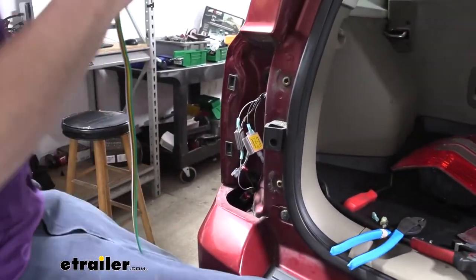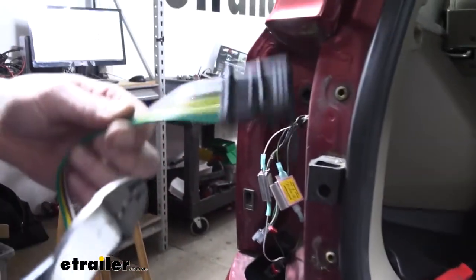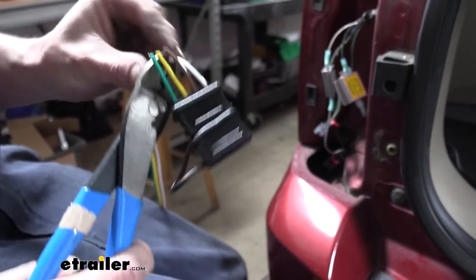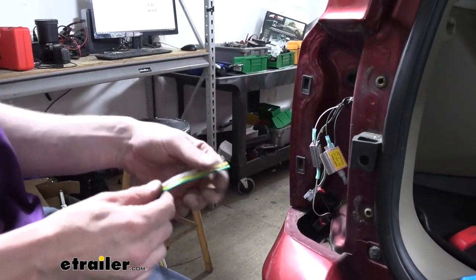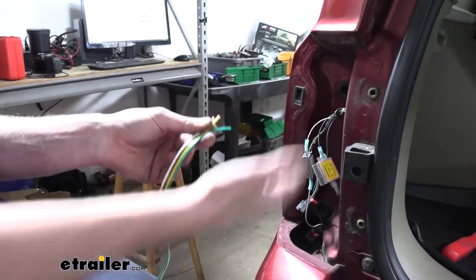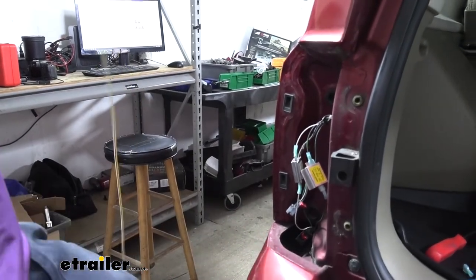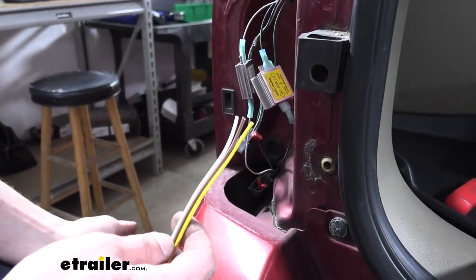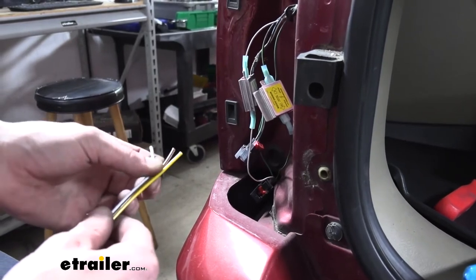We're going to go ahead and take this wire here and snip off the end we don't need. I did snip it off at a point where the wires were separate, because we are going to need to separate these wires. The green wire here doesn't need to be on this side at all — it only needs to be over on the passenger's side. So you can go ahead and peel that back some, all the way over to the other side. These remaining three wires we're going to bring up from the bottom behind our fascia here up into this location so we can attach them. We're going to use a fish wire to do that, with some electrical tape to pull it up.